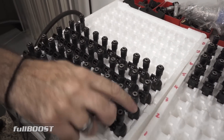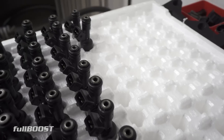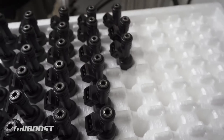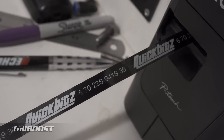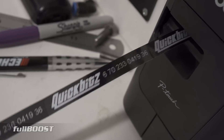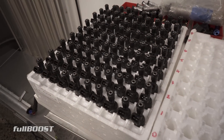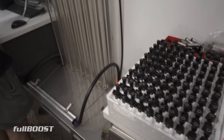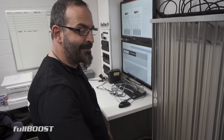And then we put them in order — so that's injector number one, 10, 11, 20 and so forth until we get to 90. I can go back to the spreadsheet. Then what we'll do is give the bodies a good clean with some brake cleaner so that we can put our own label on there, and then we'll sort them in their random order. Once we've got our spreadsheet, we'll print off some labels. We've completed the whole box now — that's 90 injectors all flowed. We're going to leave them in their current order because we don't want to mess up the labeling process. We'll clean the bodies and attach a sticker around the body of each actual injector.